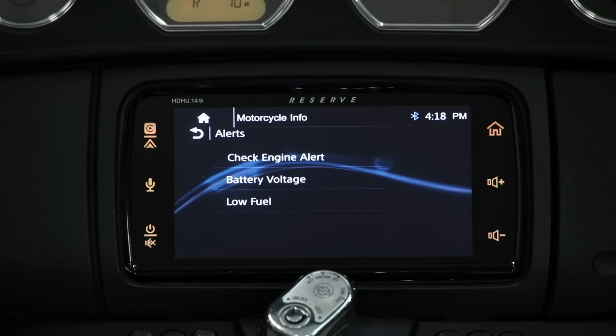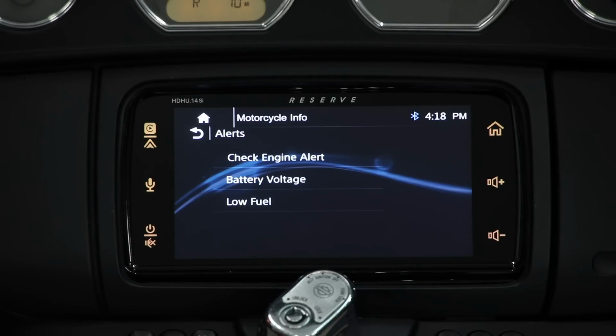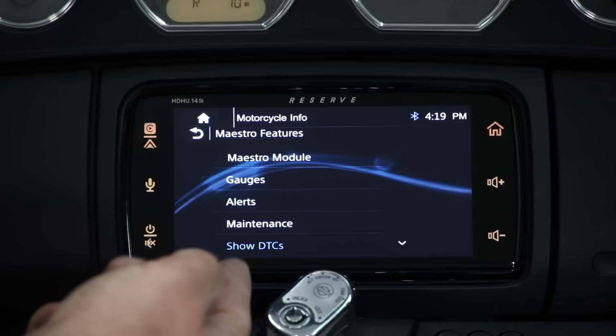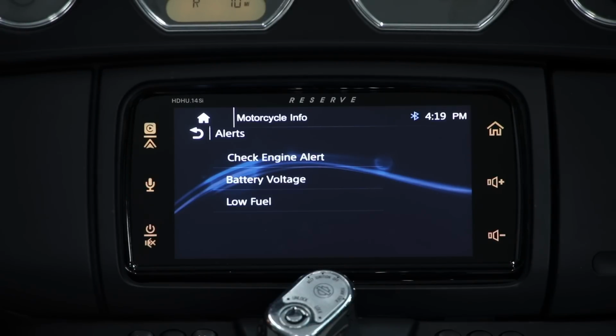So some of the bikes have an oil pressure sensor that is monitored, and when it's being monitored, some of them were actually set up where the oil pressure was way too low. It would say it was too low, but it'd throw up an alert, and it was false. You can go in here and you can actually change those alerts, and you can make it where the PSI is lower. The new software revisions from iDatalink preset that to 5 PSI. Originally it was set at 20 PSI, so on a hot motor you'd get a false alert.